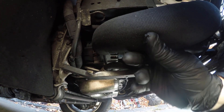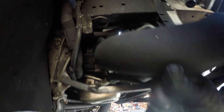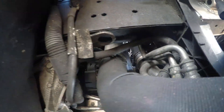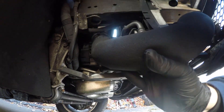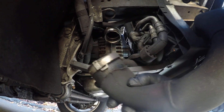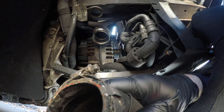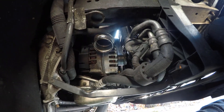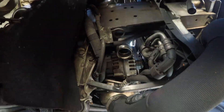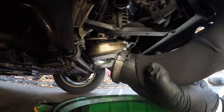This is the big charge hose right here in front of the camera. The metal pipe is up there. It should be a seven millimeter. I've already loosened this one for demonstration purposes — I can just pull it right off. They will usually not come off this easily. Nice little seven millimeter worm clamp, and this thing was full of oil. That's why I have the green drain underneath to catch all the oil. We've put our fitting in here.